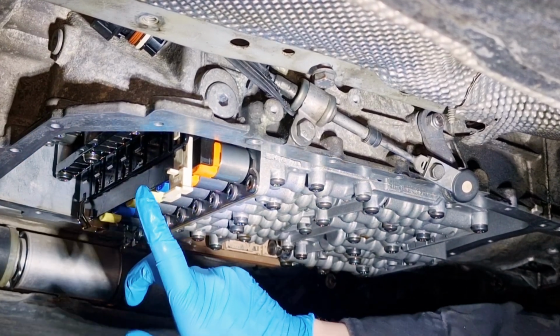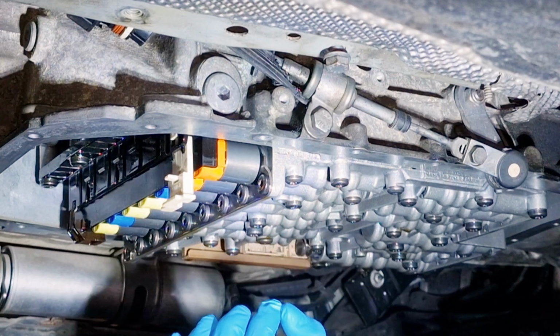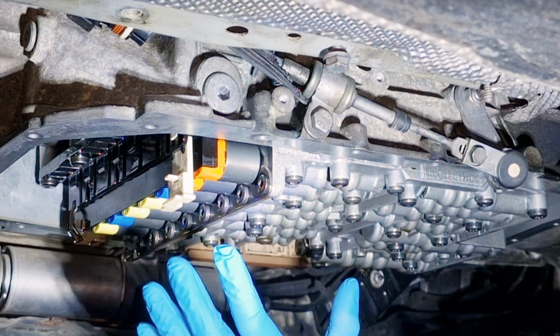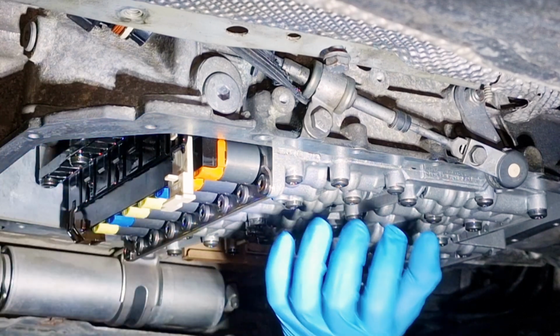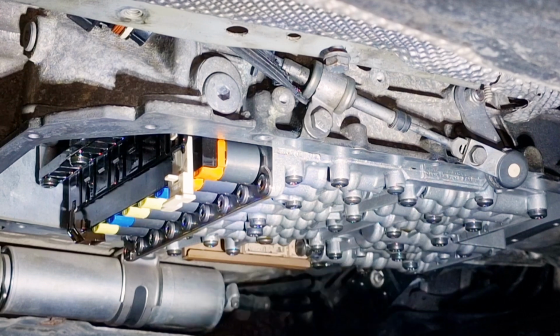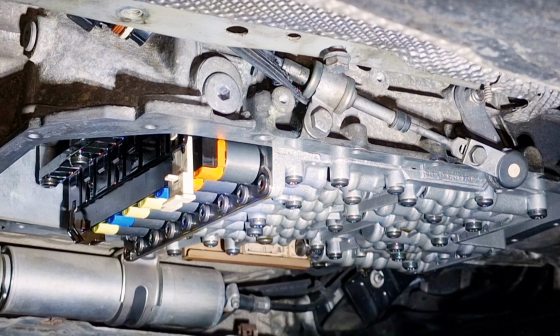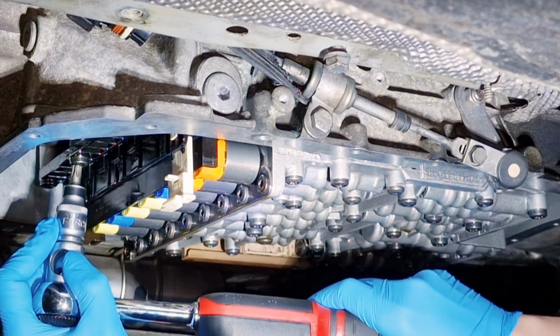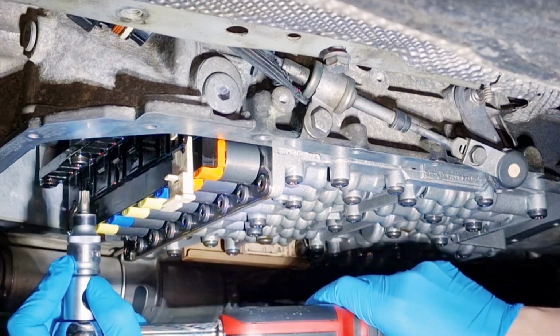I will just in case double check the torque for them. Okay, I double checked those 3 bolts and really the torque is 8 Newton meters. So 6 was for the TCM and all that plastic stuff on the mechatronic itself, but all those T40 bolts, those are 8 Newton meters. Kind of logical, but still, they keep these plastic things, so I decided to double check. So, okay, let's torque it. I mean the central first. 8 Newton meters. Okay.